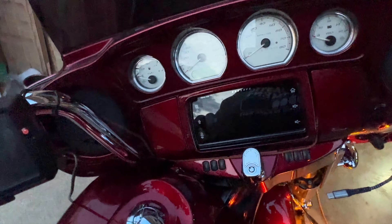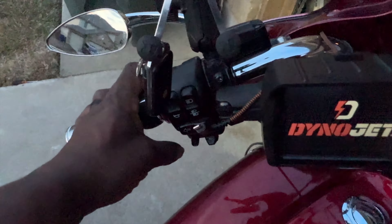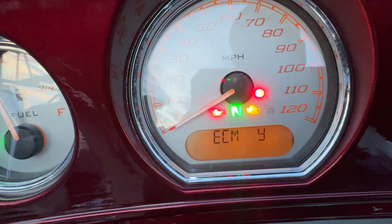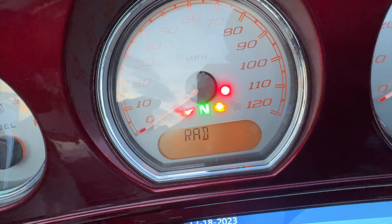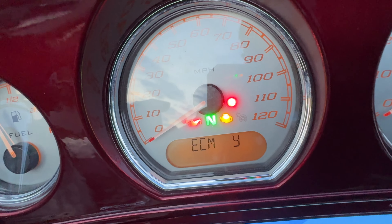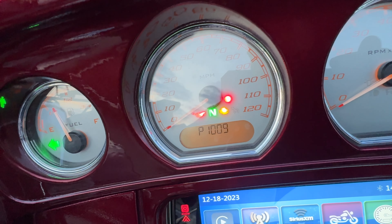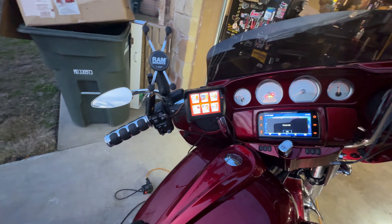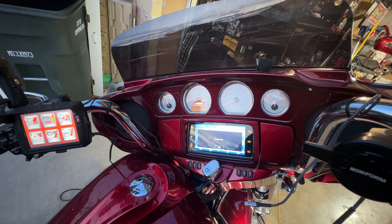All right, so I figured this would be a good chance to show you how to get your codes if your bike is throwing any. You're gonna hold down this button here, turn the key on as you continue to hold it, and once it comes up DIAG you can let it go. Once you hit DIAG, it's gonna say ECM has codes — yes. BCM also has codes — yes. Speedo — no. Radio — no. The code for the ECM is P1009. That code prompted something like a password issue for the ECM. But now the bike won't start.